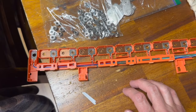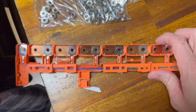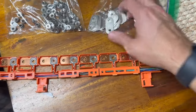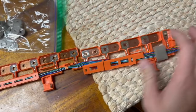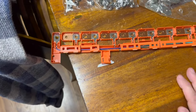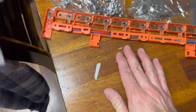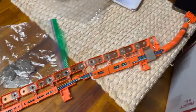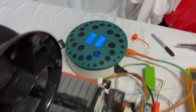Look what just showed up — my friend Len from Hybrid CPR up in Spokane sent me a new harness. All of these have nice, clean, beautiful copper bus bars. We're swapping out for these nickel-coated ones and using stainless nuts to give this battery the best chance of coming back to life. No more junk harness. The battery is still undergoing its reconditioning process, but when it's done this goes on and we get the car running.